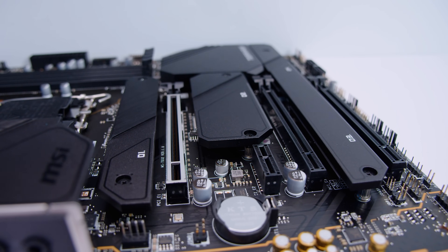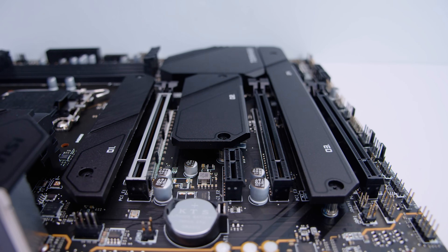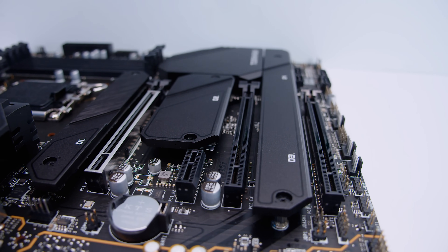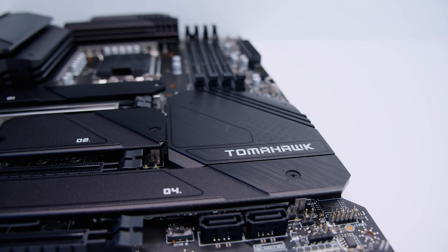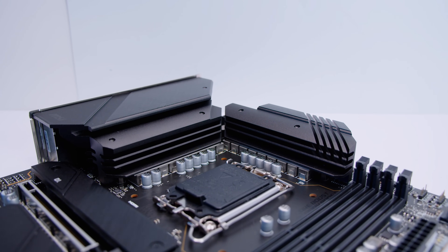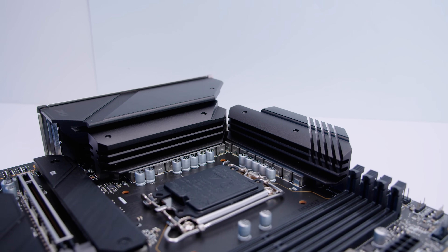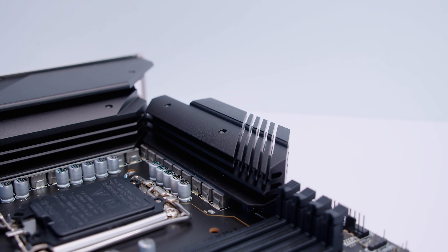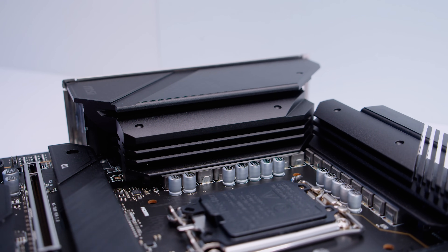There are two 8-pin EPS power connectors to send juice to your brand-new 12th Gen Alder Lake CPU. Looking at the PCIe slots, the top one with the metal shielding is a full PCIe Gen 5 x16 slot. The rest of the slots are PCIe Gen 3 — even the x1 slot. The two x16-size slots are Gen 3 but x4 wired. This features Intel's brand-new Z690 chipset, which doesn't require active cooling at all — just a regular heatsink. For power delivery, it features a 16+1+1 phase digital VRM setup with 70-amp smart power stages, for 18 phases total. The cooling on the heatsinks is more than adequate, and the whole IO cover is essentially a heatsink for that part of the VRM layout.